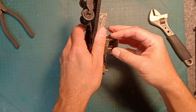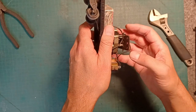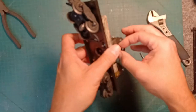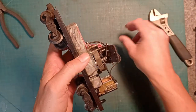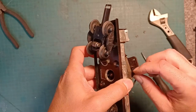This is tight. So we'll just get that out of the way carefully. Yeah, I can already see the brushes are really bad — they're pretty filthy. There's a lot of carbon buildup on that. So right away, we'd have some issues with it.